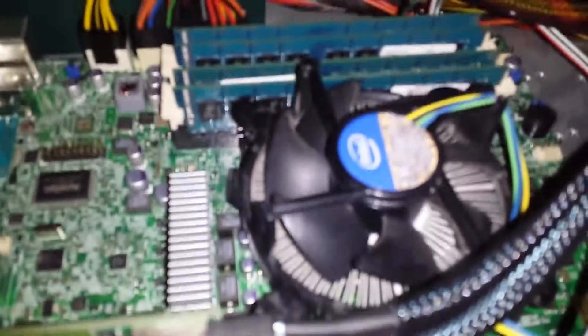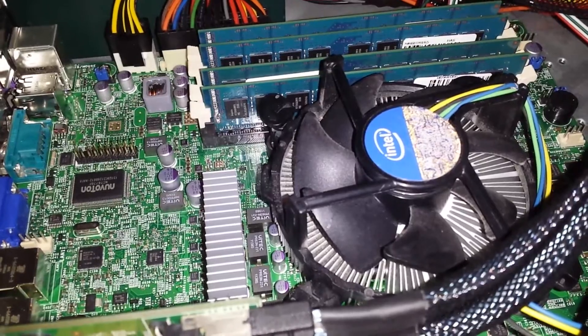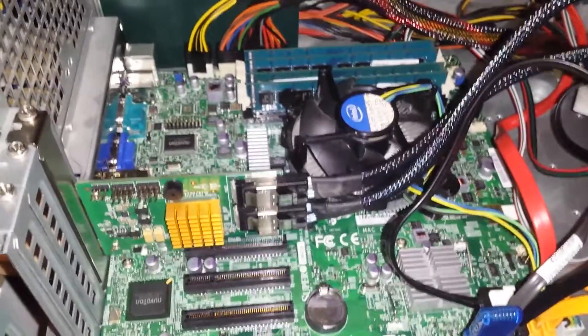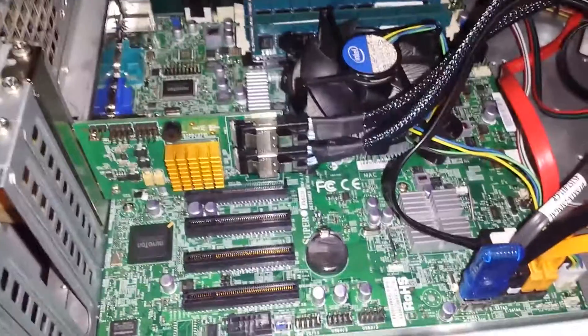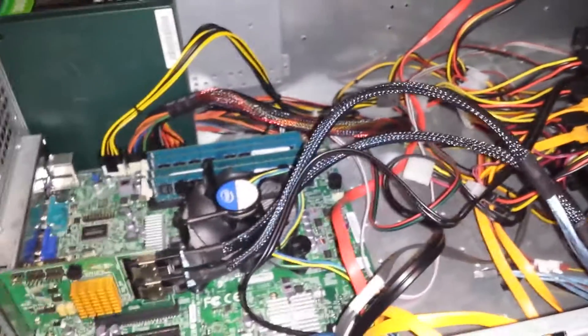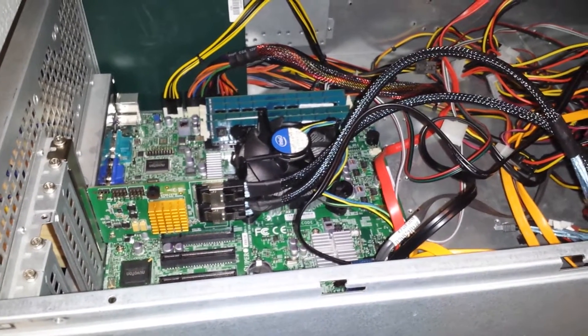That's the X9 SCM with 32 gigs of HyperX RAM — ECC unbuffered. This board will only work with unbuffered ECC RAM, I believe. There's a C program I saw online that you just compile and run, and you can see if you're getting ECC working — it'll check if it's possible and if it's actually enabled. I'm going to check all that and make sure it's working, because otherwise this will be a whole waste and I might have to upgrade my CPU. But I'm pretty sure from reading the forums that very similar CPUs do have ECC support. Anyway, that's the X9 SCM — I hope you enjoyed this video. I think this is a good buy if you want ECC support. See you guys later.